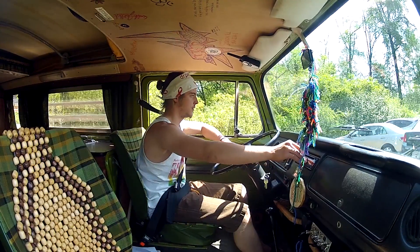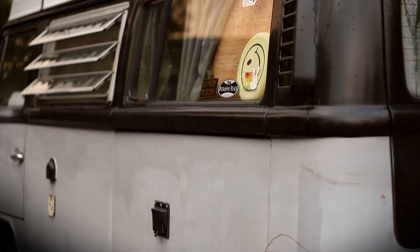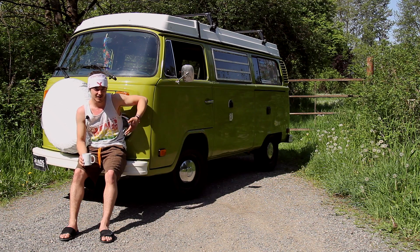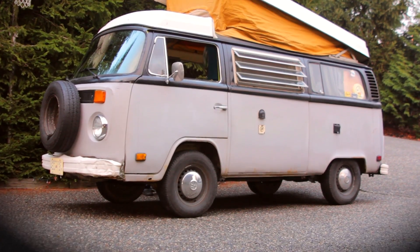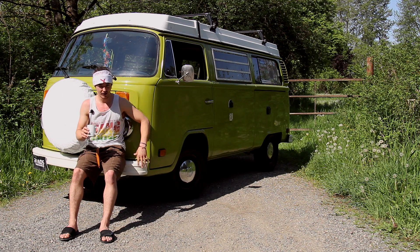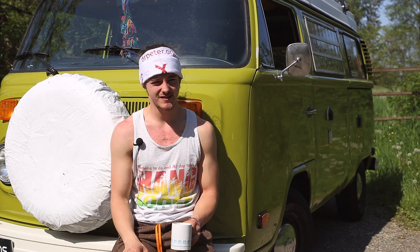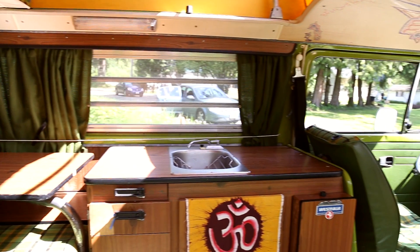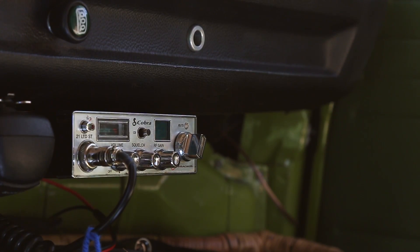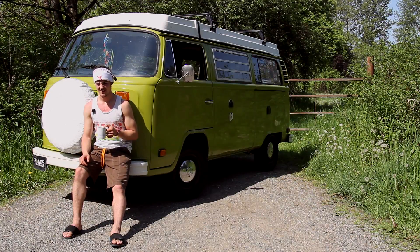The big thing I did was the paint — my dad helped me out since he's done eight or nine cars. The previous owner had dinged up the front badly and done a really crappy Bondo job, just Bondo'd over everything. When we started taking it apart, the Bondo wasn't even attached to the metal — there was just a layer in front with water in between. So we had to completely redo the front end, cutting chunks out and welding in new pieces, installing a brand new bumper, and remounting the tire. I've also done a lot of interior cleaning since it had been sitting for six years with mold and algae. When I bought the van I started a YouTube channel called Westphalia Life, Life on the Roads.